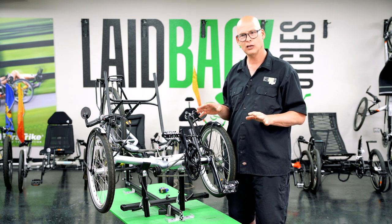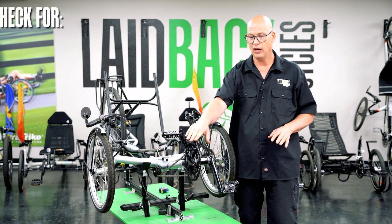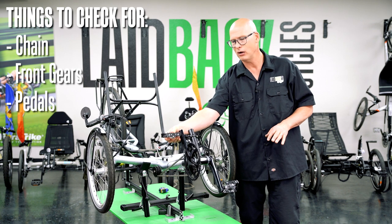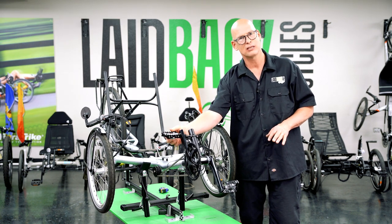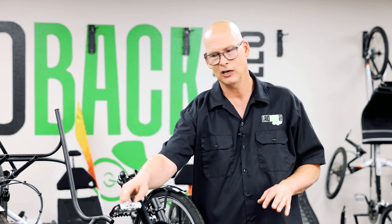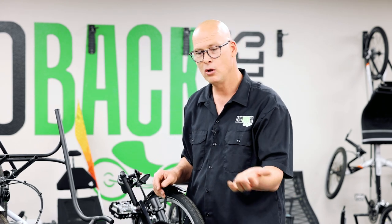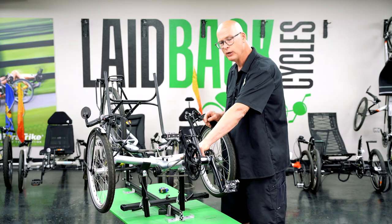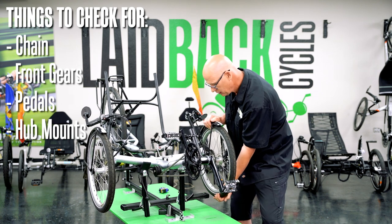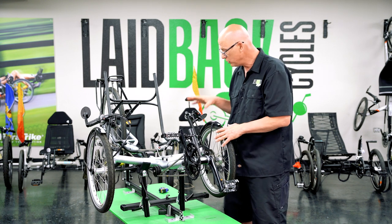There are a lot of things to look out for. Going front to back: check if your gears are messed up; check your pedals — do they wiggle or have a solid feel? A lot of sealed bearings go bad if they're worn or not maintained. Check your chain, and then check your hub mounts. On this one the hub mounts feel pretty solid — not too shabby.